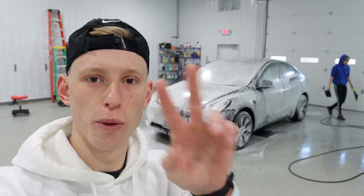So we foamed the vehicle twice. The first time is just for washing the vehicle. The second time is we're gonna use that foam as lubricant for the clay mitts and clay bars. Plus there's also more iron remover in the foam cannon still, so we get to use iron remover twice on the paint.